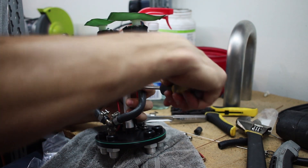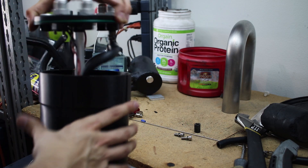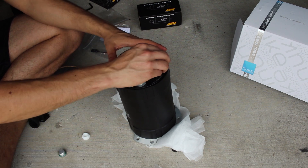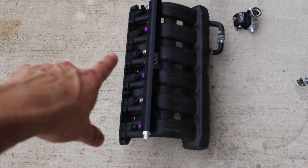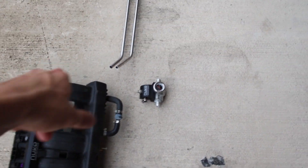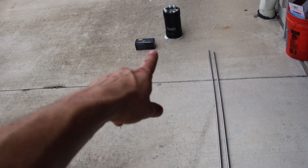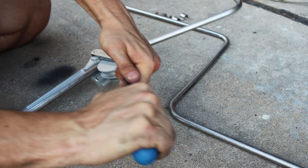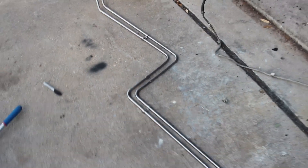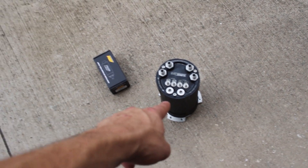I hope that explains why I'm doing what I'm doing. I hope you guys do some more research into the products — I can speak for their quality having this in front of me, and it is very, very high quality. Here's the manifold with injectors and fuel rail. This is the return fuel line from the fuel rail that goes back to the surge tank — that is where the fuel pressure regulator goes and it regulates the fuel pressure. This other hard line next to it is my feed.